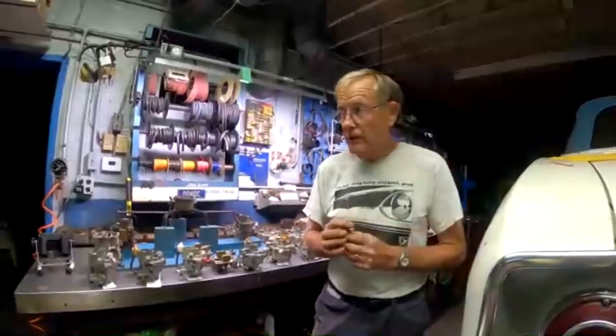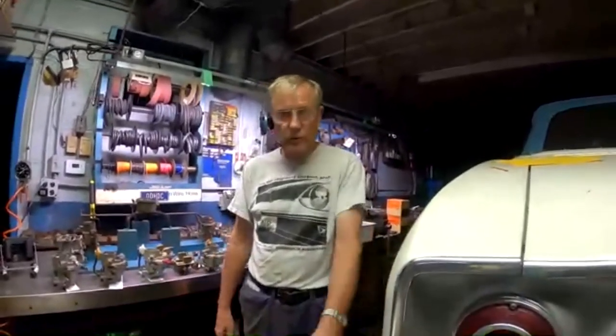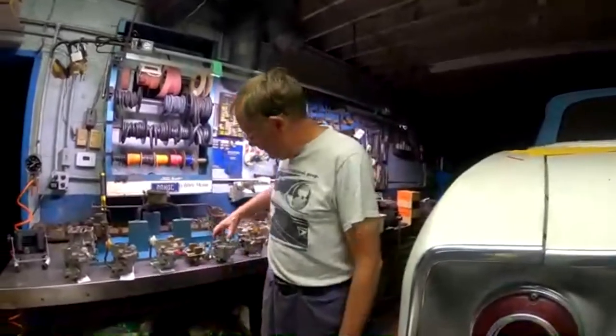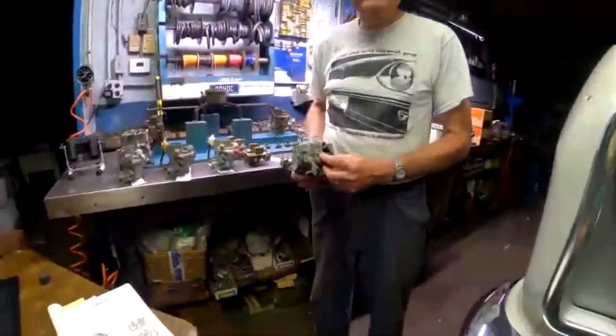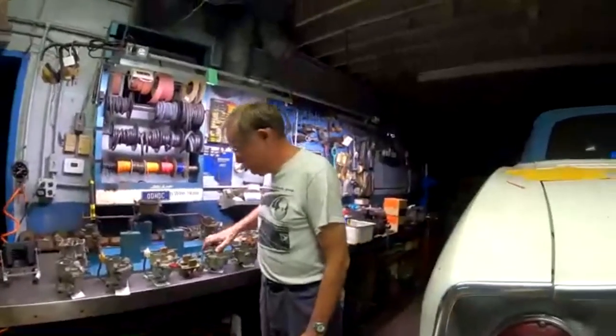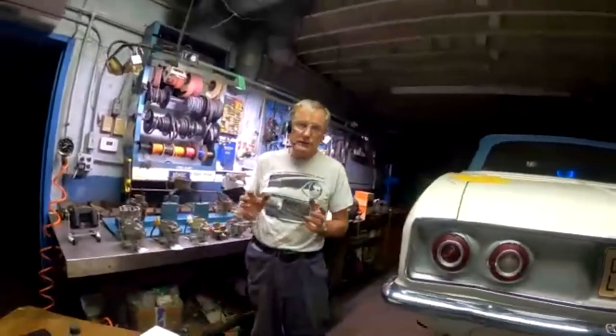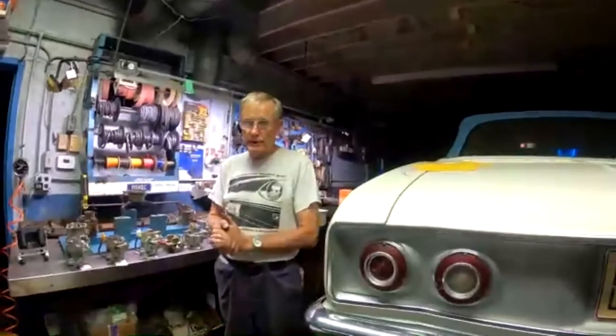Okay. I would be careful about carburetors that are so-called rebuilt by people who are not Corvair experts. You know, "Send your carburetor into us and we will fix it." Oh, they'll fix it all right. I've seen so many carburetors where they just had a pile of Corvair parts and they took yours apart and reached in the bin and found one of these, one of those. And hey, if it had that idle air passage here, but we don't have the parts for the rest of it, well, we'll just plug that hole up right here, disable that feature. If it's not somebody who's Corvair knowledgeable, and really you had to be pretty knowledgeable to know all these differences to get an exact match pair. And that's the goal here, an exact match pair so they're the same on both sides.